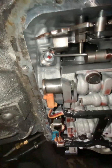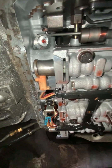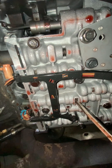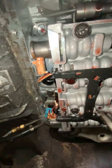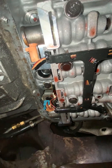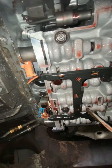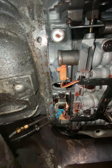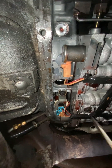Then I remembered — they mention it in the other video — you have to take your screwdriver and pry this as hard as you can. This is a main component. You can fiddle with the clip all you want, but if there's no pressure on the clip it's not going to do anything. I had bent the clip so much from working on it so many hours that I took the screwdriver, put it in here — there's a spring — keep pushing as hard as you can and this retainer will start to come out. I just kept pushing and eventually pushed it out. The clip was useless at that point, just dangling because it was so bent.